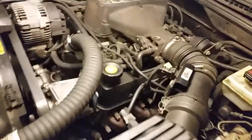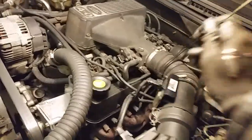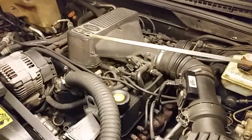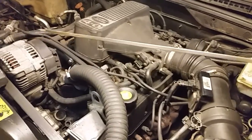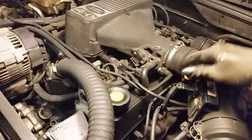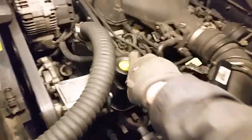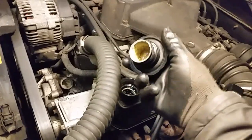What you want to do when you're going to buy a car — pull the dipstick out like this, look at that thing, make sure that oil is nice and clean. Mine's not too bad and you don't see any moisture there, so that's a good indication the engine could be okay. Then simply find your oil cap and pull it off like this and look underneath.